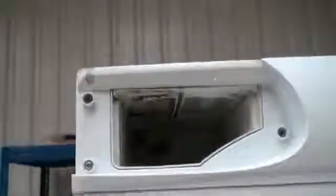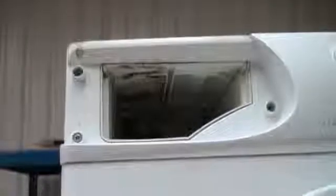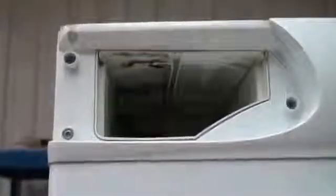Water will then enter your dispenser drawer via the dispenser housing, where your fabric softener and detergent is. We get a lot of customers complaining to us that their fabric softener or detergent isn't being taken into the machine. And the biggest problem is that the dispenser housing is actually blocked up. If we take out the dispenser drawer, we can take a look at the dispenser housing itself from inside, and as you'll see by this one, there's a lot of black mould and gunge that is blocking the holes so water can't drain into the dispenser drawer and take away that detergent and fabric softener.